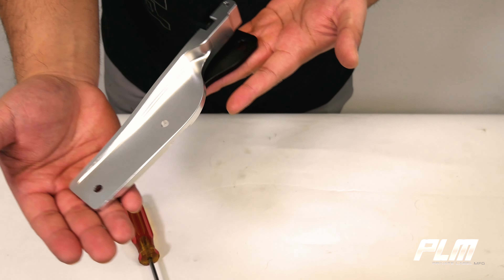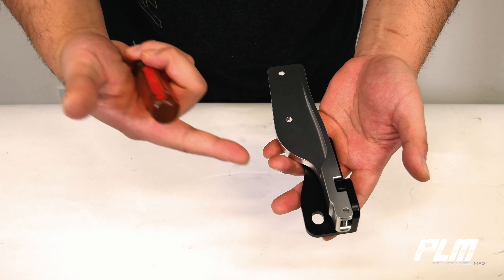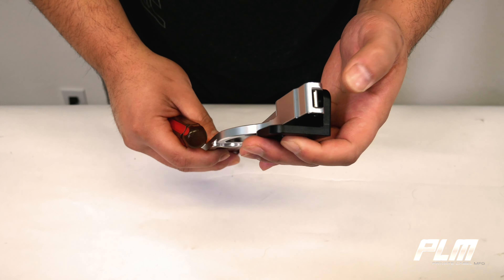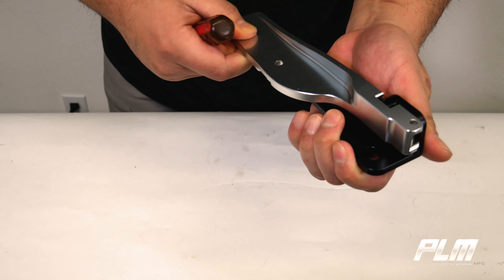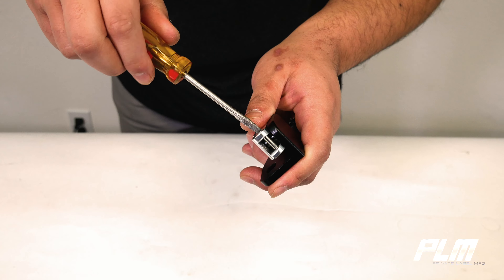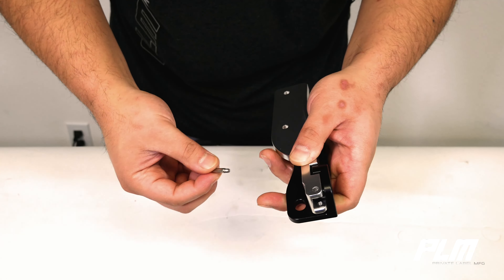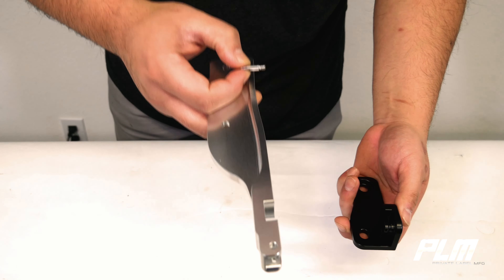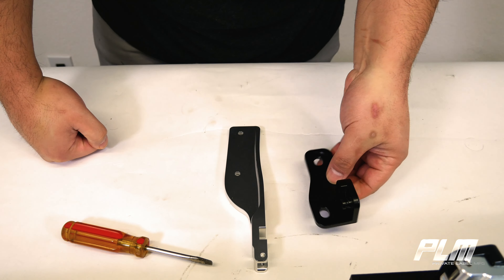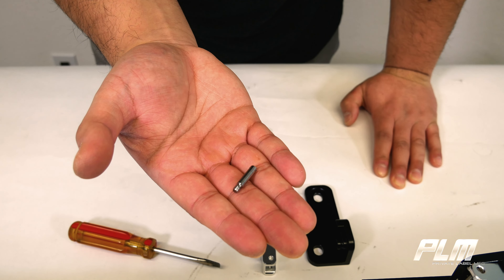This, for example, comes in three parts. For the quick-release function to work, you're going to need to remove that safety pin there. That pin essentially locks it in so it doesn't go anywhere. With a flat-head screwdriver, I'm just going to go ahead and remove that. This hinge comes in three parts: safety pin, top hinge that hooks up to the hood, and bottom hinge that goes to your chassis. Do not lose this safety pin — it's very important.